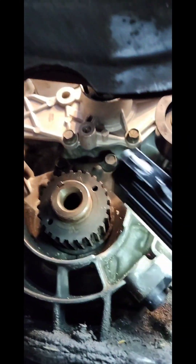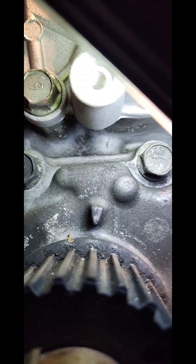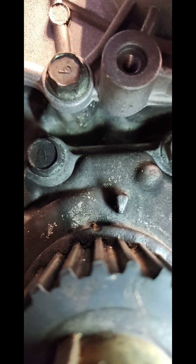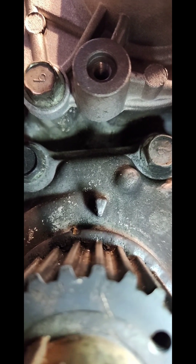So here we are on the bottom. This is your timing belt cog on the crank pulley. That casting at 12 o'clock — that's your mark. Now as you can see, I've rotated it back one tooth. We are physically back one tooth. So that's your 12 o'clock, and that casting is where you need to be. Here's why.